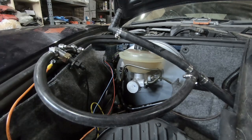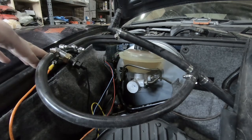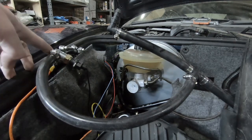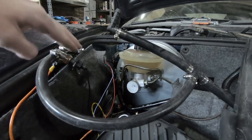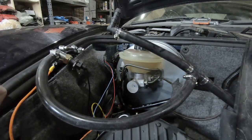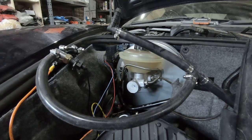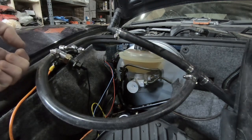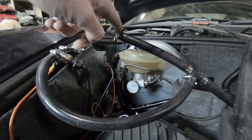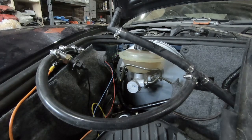There have been a bunch of comments with a few different things I can try. One is that maybe the setup isn't right and there's not enough difference between what it takes to switch it on and off, in which case I need to find a new switch. Another person suggested potentially using two switches. And then another point was that perhaps the switch is just too close to the pump itself, and the airflow and switching of the pump is confusing it. So what I'm going to do is take out the switch and relocate it in-line much closer to the brake booster, well away from the pump and after the T-piece with the reservoir.